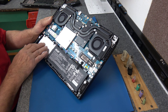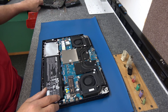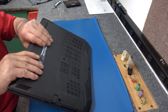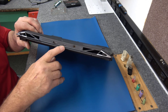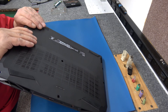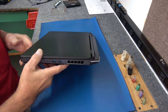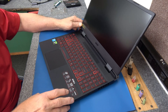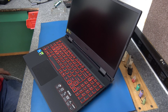You can also add a 2.5 inch SATA SSD over here — 4 terabyte, 1, 2, 500, whatever you want. Let's flip it around and throw the bottom cover back on. I always wait to put all the screws back in until I'm sure I don't have to go back inside. Carefully go around and click it back in. In the back you've got the charging port, Thunderbolt, HDMI — they say that's a Thunderbolt 4.0 USB-C. Over on this side you have USB, headphone, your killer Ethernet. Let's boot it into Windows. It might take a minute to post because of the new RAM, which is totally normal — don't panic.